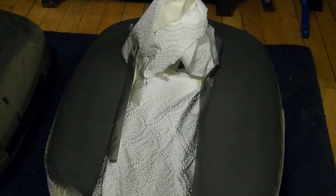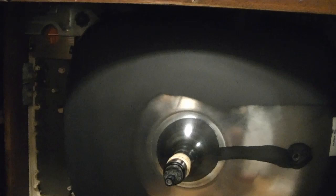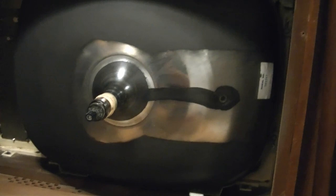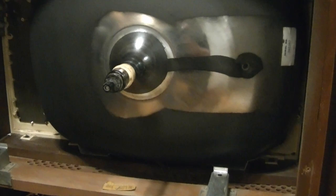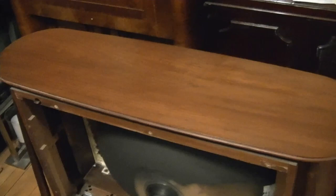It took me about four attempts of adjusting the band to get it centered in there just right, with a nice even gap between the CRT and the front bezel. There's still a little bit of work to do on the chassis — I'm going to do a final check-out, do an alignment, and then start putting this thing back together. And of course, continue to work on refinishing the top. After getting the CRT installed, I put the back back on to make sure it would fit, and there's plenty of clearance on the neck. In fact, I think this neck is slightly shorter than the original.